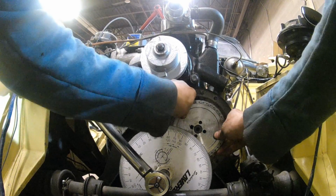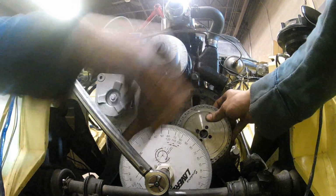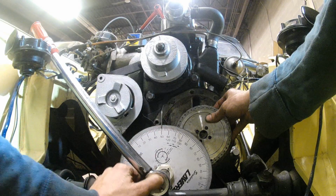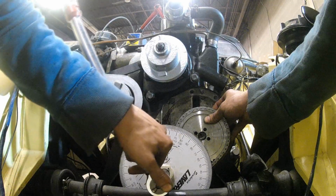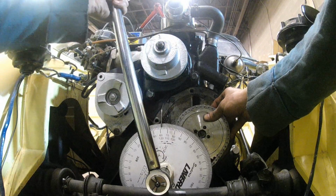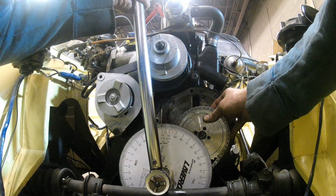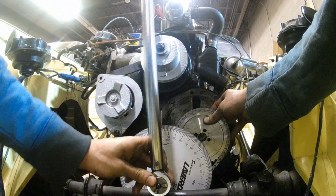Just turn the gear by 90 degrees, which is not exactly 90, it's going to be 92, let's say, and this gives you a quarter of a tooth adjustment. If you're still not satisfied, if you still need to move anything, then turn the gear with the back part to the front, and then you're going to be at half a tooth difference from your original position.